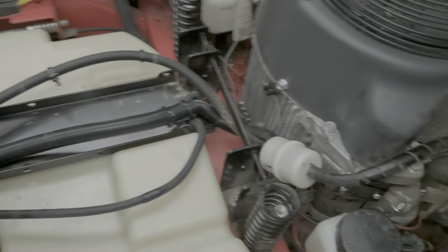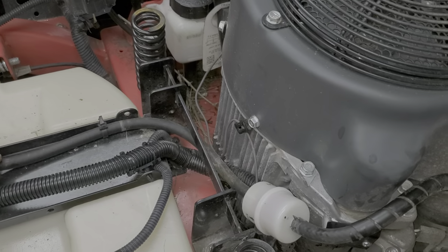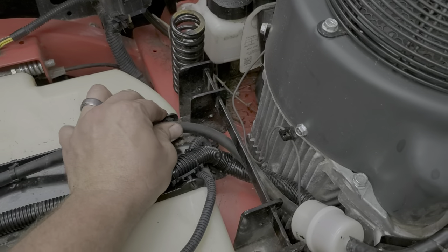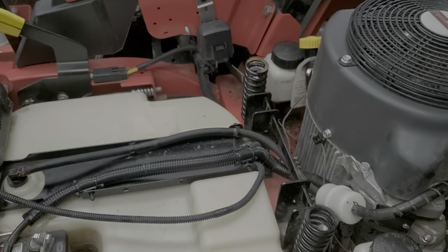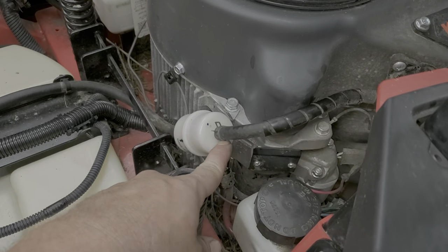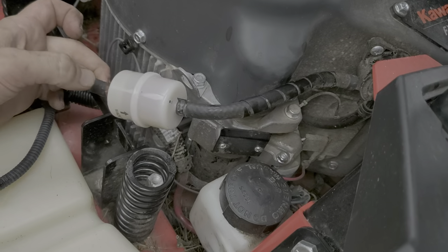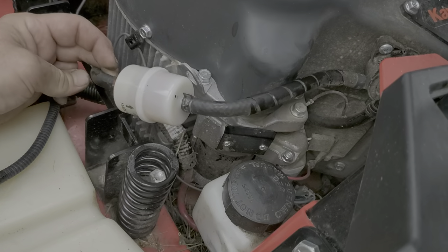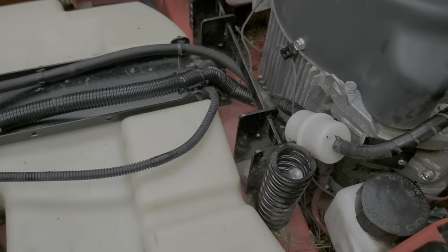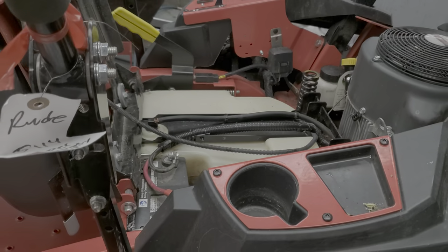Even though it's showing good flow past your fuel pump, that doesn't mean it won't be restricted if you pull that same amount of fuel for a long period of time. Number one issue on these: if it's running for half an hour or 45 minutes and shutting off, and you think it's overheating, nine times out of ten it's fuel-related. Check your fuel flow, check anywhere something can get clogged. Fuel lines can deteriorate and catch debris right at the inlet to the fuel filter. Check any place it gets small — connectors, fuel shutoffs — check for restrictions. Thanks for watching, like and subscribe.